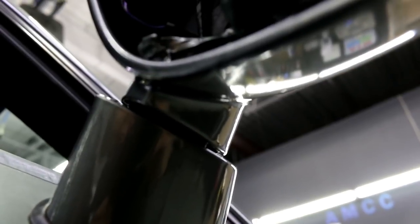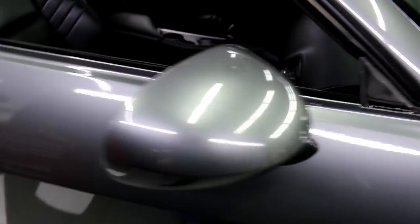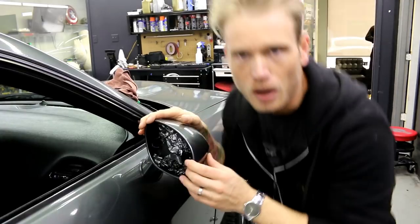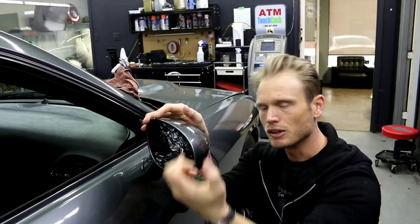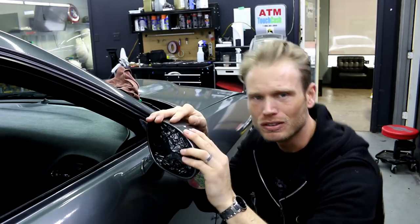Let's check it out — right in the bottom. Let's try and get the camera to focus. You can see all that — I'm not trying to hide anything. Let's smooth that out. I'm happy with that, guys. I'm going to go ahead and post-heat to about 180-190 degrees, making sure that we don't have any pullback, and then I'm going to slap that piece in there and call it a day. I hope you enjoyed the video — if you did, give it a thumbs up. If you want to see more, hit the subscribe button. Thanks for watching. Take care.